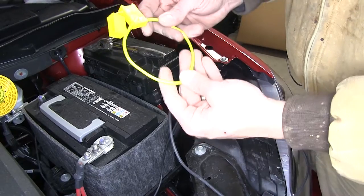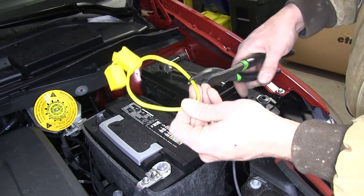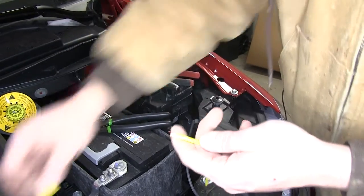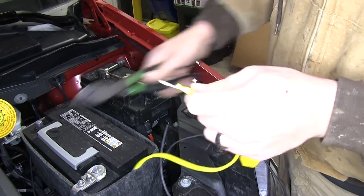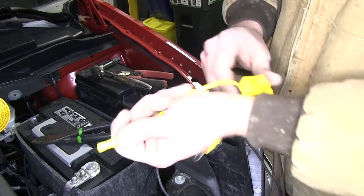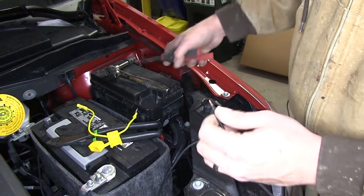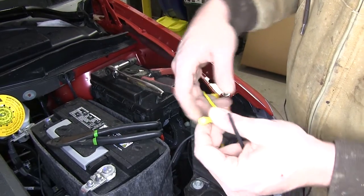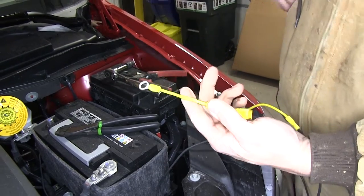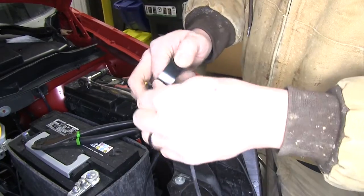When it comes time to make our connection we want to add our inline fuse in place. We're going to cut this in about a 60-40, leaving one side just a little shorter than the other. On our short end we're going to put our ring terminal, and on the longer end put our butt connector. We'll also strip back the end of the black power wire we ran from the rear — that's going to go on the other side of our butt connector. Pull on each connection to make sure they don't slide out, then cover them with a little tape to help protect them.